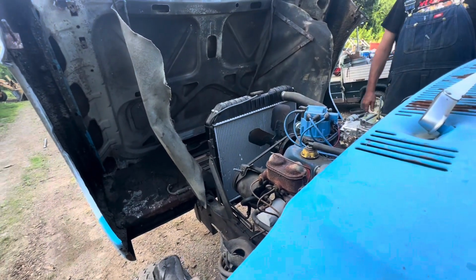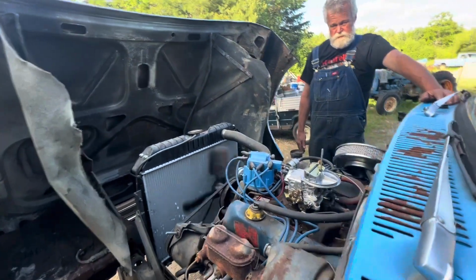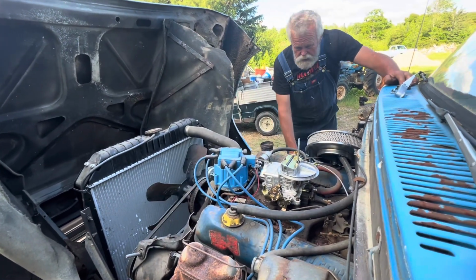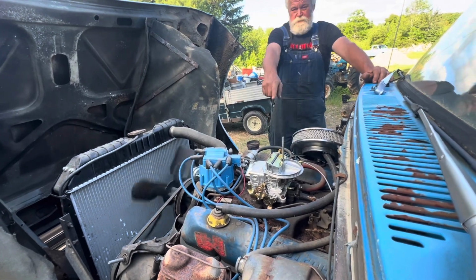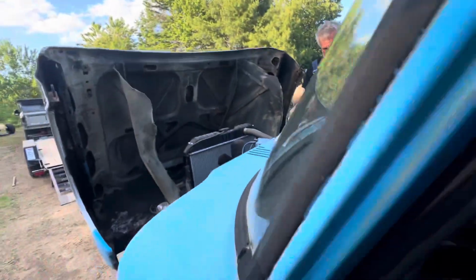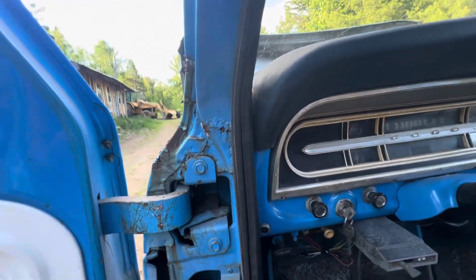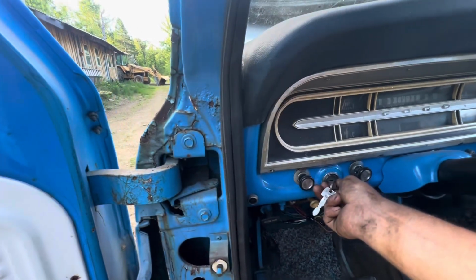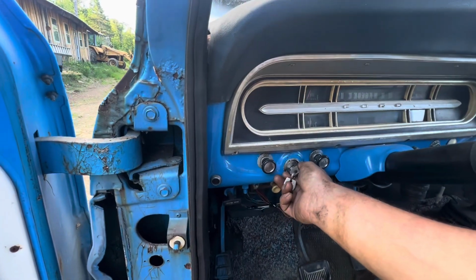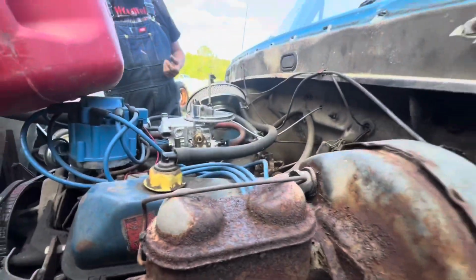Needs a little more of that fancy juice you got. Ooh, I can see fuel in the float bowl. That's perfect. Hold up. Choke off? Yeah, choke off. I'm going to put a primer in there. Let's see if you catch it on the fuel pedal once it lights. Dump some fuel down its throat.